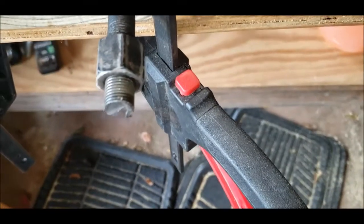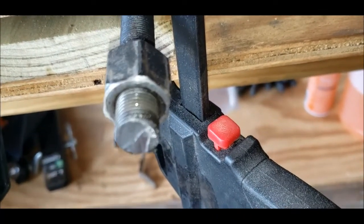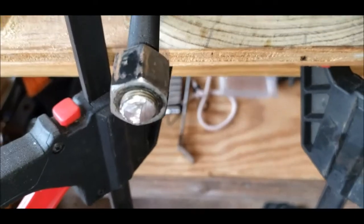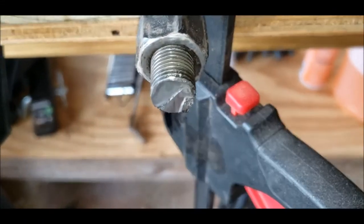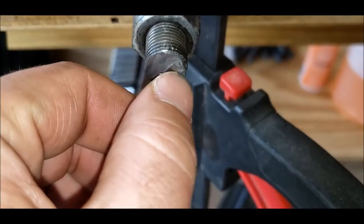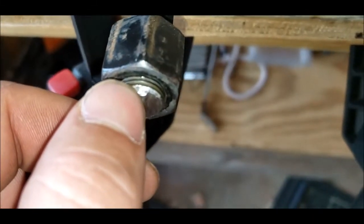All right, so just cut this one off, and I wanted to cover what I'm doing exactly in a little more detail. I haven't cleaned this one up, whereas this one I have cleaned up. So, two steps to it. One is I'm gonna take the Dremel on a lower speed, go around the edges, clean up some of it, and overall just bevel the edge slightly. You can see this is beveled.